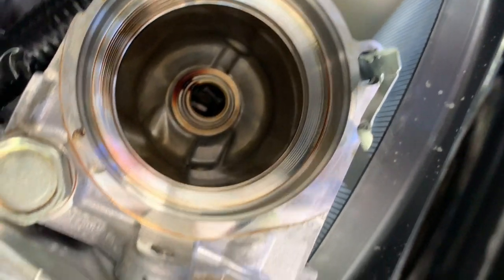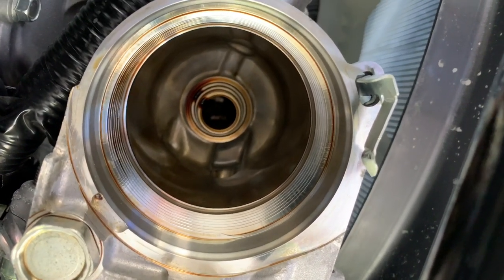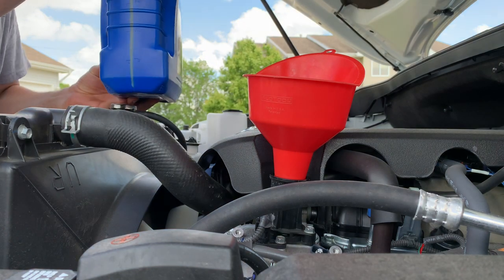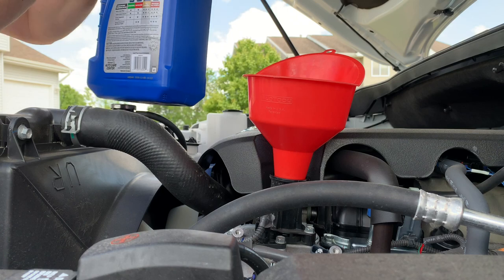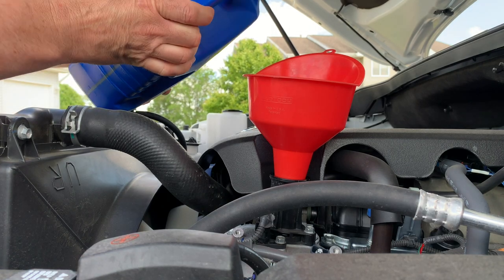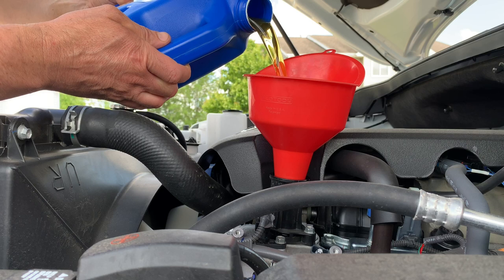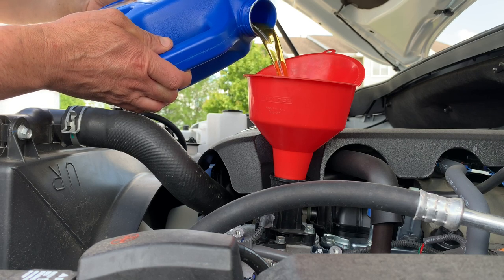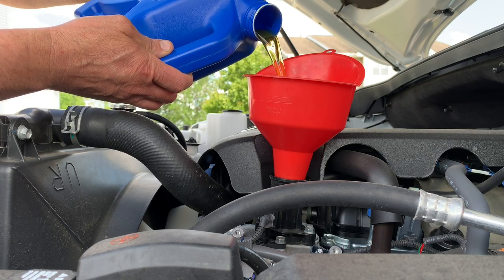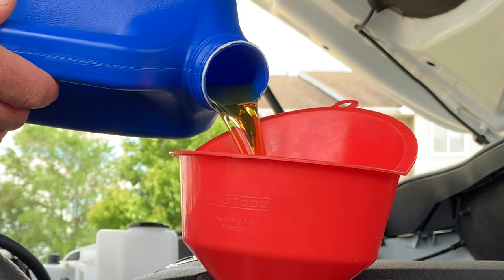Same results. We're going to switch out the filter — here's the old one, and here's the new one. That's what it looks like up inside there if you're curious. Clean it up and screw everything back in. Make sure it's tightened down to 25 Newton meters. All right, folks — this is the correct way to pour fluid. I see so many people doing it wrong and all that amounts to is glopping. So turn the jug upside down — nice and easy, not making a mess. This is an 8.5 quart capacity: 5 quarts plus 3.5 out of the second jug, leaving 1.5 quarts left. As you get down to the last bit of fluid, you can rotate it. I see so many people spill — and there is not even a drop spilled.